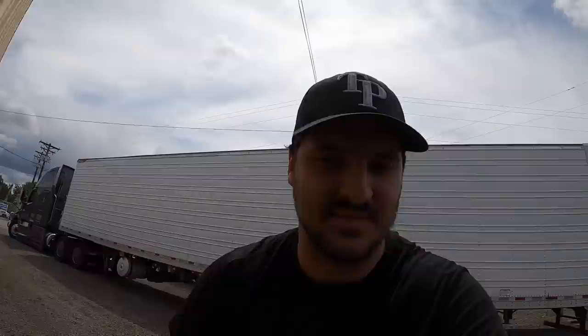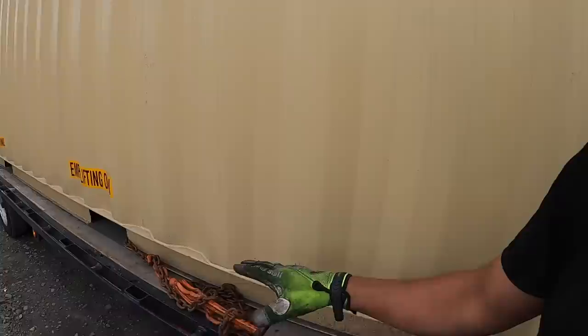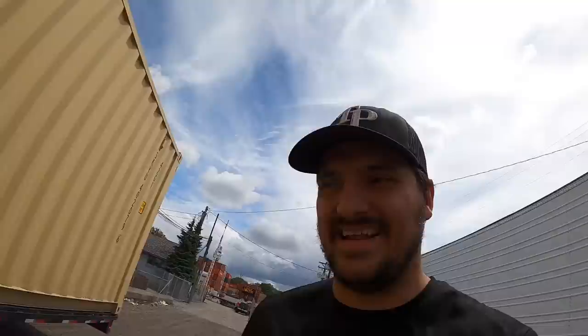The only thing is, he didn't quite put the container right in the middle of my trailer, so there's more room on the passenger side than on the other side. Because there's more room on one side, you want to put your ratchets and binders on the side that has more room — the goal is to never have anything stick out past your rail. It looks pretty good, but honestly pretty nerve-wracking. Let's throw some straps and then get out of here.